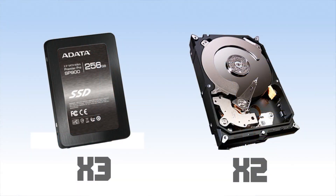For storage in this $5,000 build we're going to need a lot for video editing and large game save files. I decided to go with two 3 terabyte hard drives — 6 terabytes total — and three 256 gigabyte SSDs. The reason I split them up is so you can do RAID configurations however you want, and maybe keep an extra SSD for personal use. The SSDs will speed up the system and make boot times really snappy, all for around $600–$700.